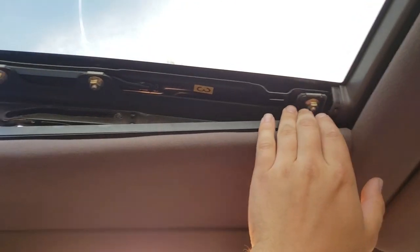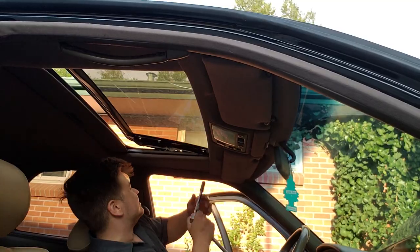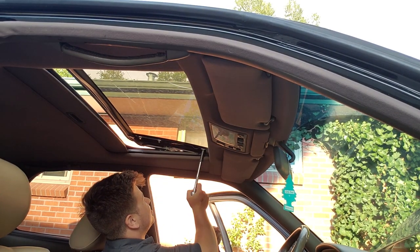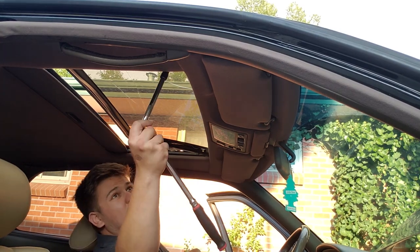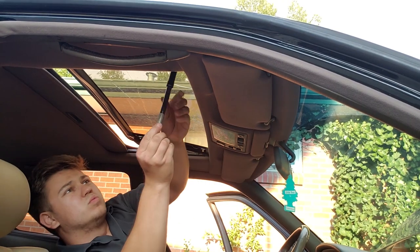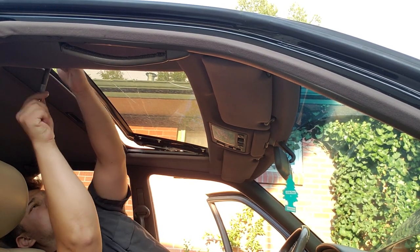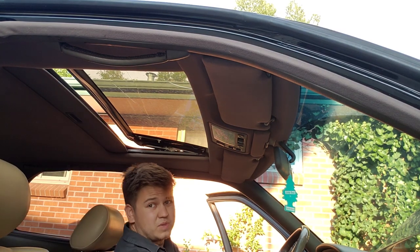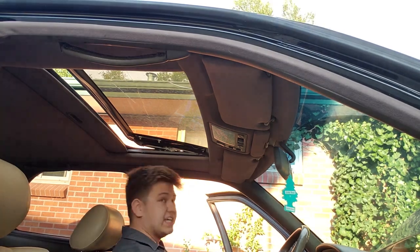It's probably pretty important that those shims go back in correctly, so just be aware of those. Then literally all you have are just these three bolts on either side — it can be removed as a unit. A 10 millimeter is going to accomplish that for us; these are not very tight. Don't lose your nuts.